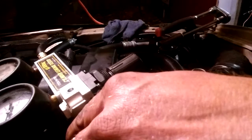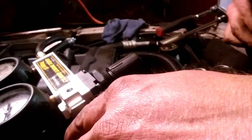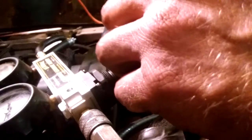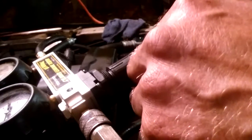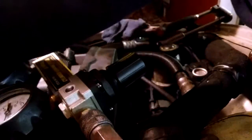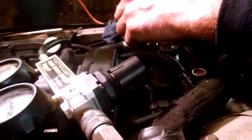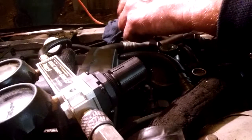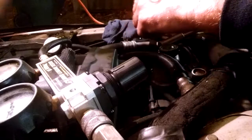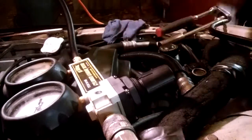Now I got this just a hair before top dead center on the compression stroke. You have to do the compression stroke. You can stick a piece of paper, wad it in there, and get a big piece because you don't want it to fall in the cylinder. Of course, it would blow out. Just crank the engine over. And actually, run the hose. We're grabbing the cylinder leak down tester hose. Screw it in there nice and as tight as I can. Now I have to force it. Put my air to it, here to the hose.